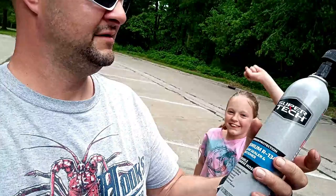We put up with this for 500 miles. It got so hot — 82 degrees outside — and it started to rain. Having the windows rolled down was keeping us cool, but when we rolled them up it got so hot and the kids about died. So I let Mariah drive and did a bunch of YouTube research. We got this can of Super Tech from Walmart. In the directions you put it on the end and read your gauge — ours was going up and down, fluctuating — and it didn't say what to do in that case. We figured we needed a mechanic, so I diagnosed everything else: looked at the compressor clutch, swapped fuses.